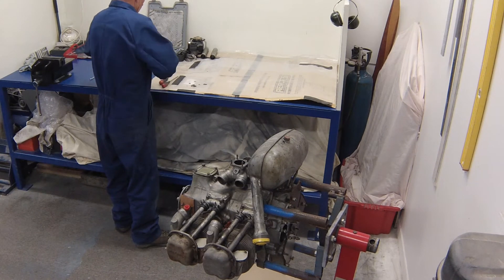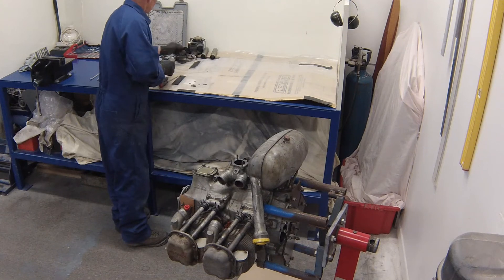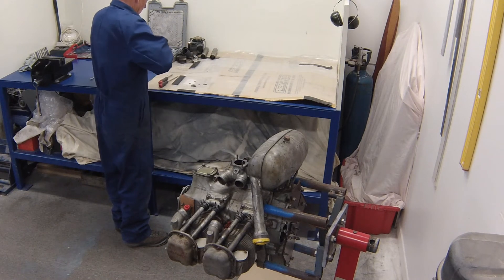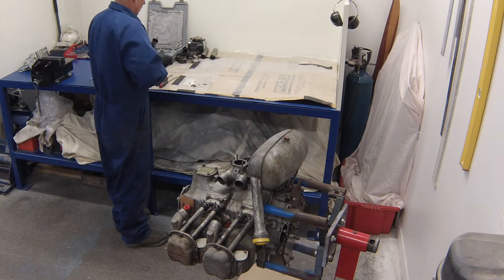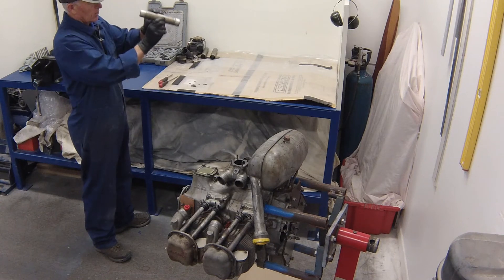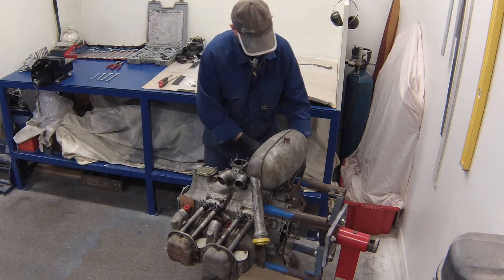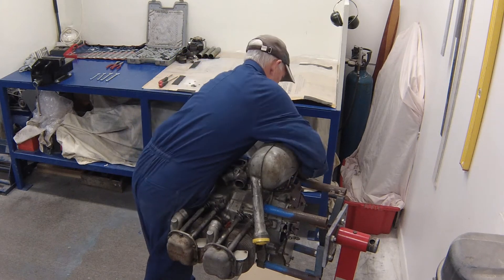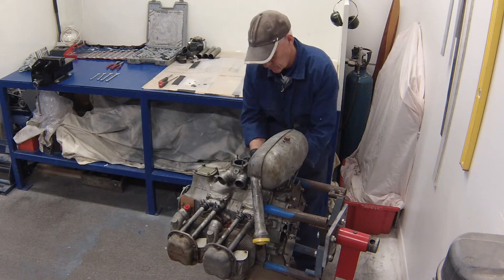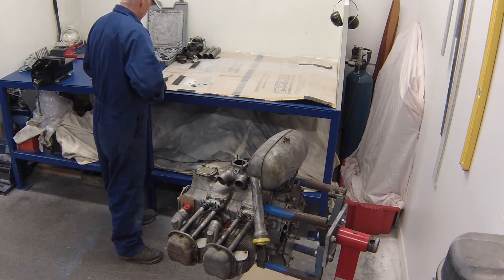If you are going to cut them off, just use a Stanley knife or a box cutter. Refrain from using hacksaws or saws because the joint is quite tight between the aluminum tube and the cast end, and you don't know whether the tube is pushed up against the cast manifold at either end. The best tool is a box cutter or Stanley knife. You don't need to slice around the circumference — just slice down the length from top to bottom, then peel them open like peeling an orange, and they will break the bond and come off quite easily.